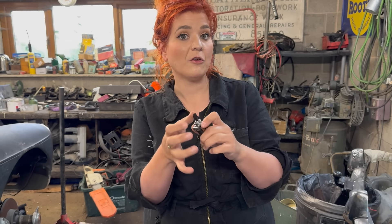We take this piece and slot it in carefully. It needs to sit over those little green circles you've just stuck down, and you need to line the holes up with the plastic piece on the dash — that's why we didn't put those two top screws in. That then secures it in. The sellotape we used is absolutely rubbish and the things keep sliding off. So: you've put on your plastic bit, screwed in this metal bit, and remember that little hole has a little flat on the top which matches up perfectly with your panel light switch, which also has that little flat on the top — so you know which way up it needs to go.